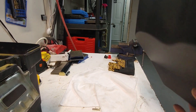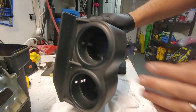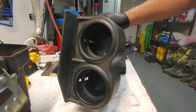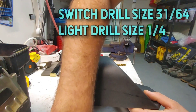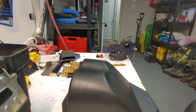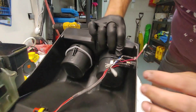Now the question is where you're going to install the switch inside the cabin. You have many options. The option I chose is to buy a dual cup holder like this, and I'm going to place it to the left of the passenger seat. I drilled a hole right there to install the switch, and I drilled another hole next to the switch for the little indicator light that comes with the kit. My switch and fan indicator LED are now installed.